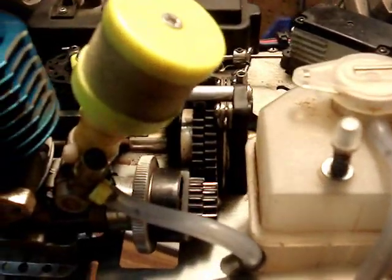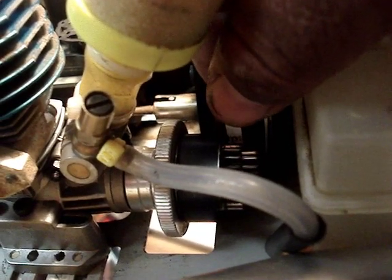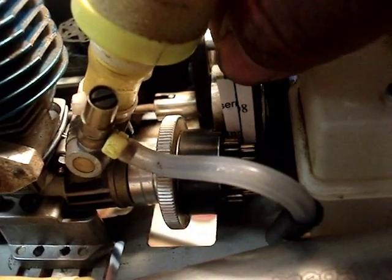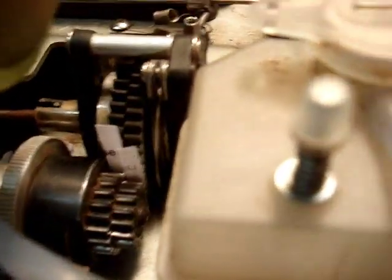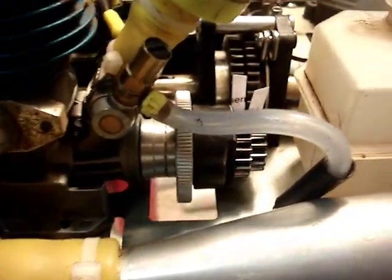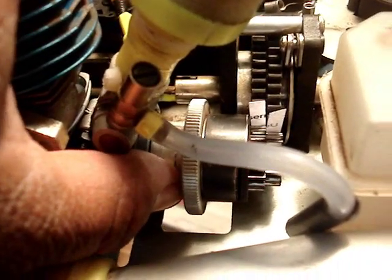I'm going to set my first little strip of paper down there in between the spur gear — the other way is down, flush — and put that other one down too. Okay, since they're both down there you can see them, I'm going to go ahead and push the motor forward against the teeth right there.